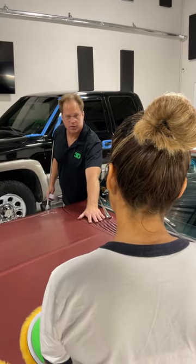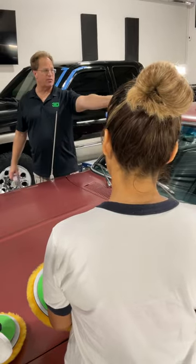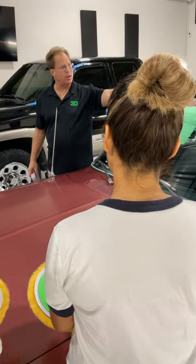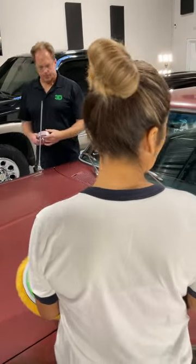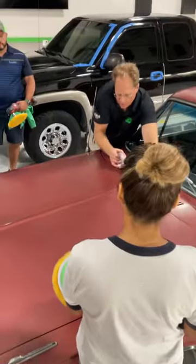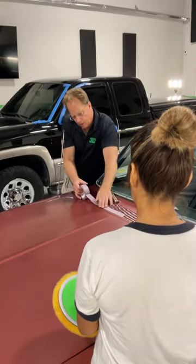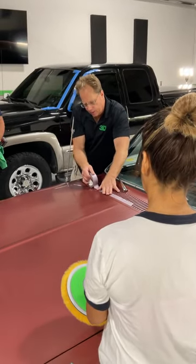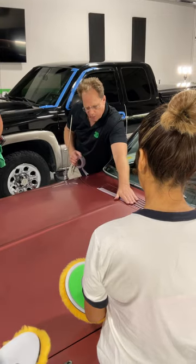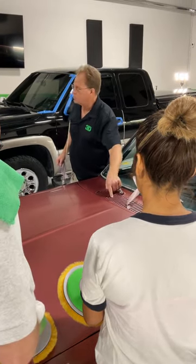I don't want to put gorilla tape on there to protect it. I want to get some low tack tape. Sometimes I just take a microfiber towel and get it wet. But this is some stuff you can get at Lowe's — I think it's for house painters. I would take and tape this off, and that would keep me from getting splatter dots in there. Because it's low tack, when I go to pull it off, I don't pull the paint off.